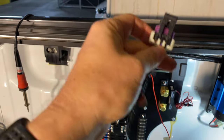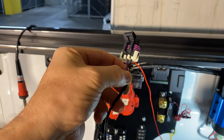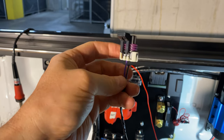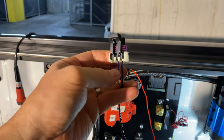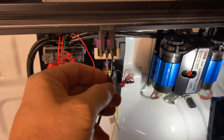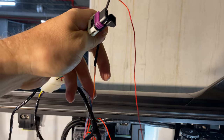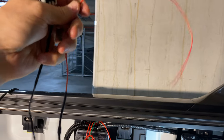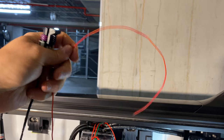All you need is that — cut that off, and you want that purple wire, that's it. The black wire is only for the ground running back to a switch if you need lighting, that's all it's for. So all you need is that purple wire, which is going to turn your internal relay coil in the compressor on or off. And you want to cut that red and yellow diode, cut it off on this side, and then join that side to the purple wire. Then connect this to your switch.